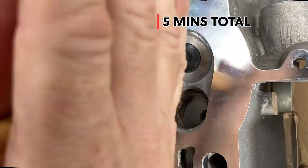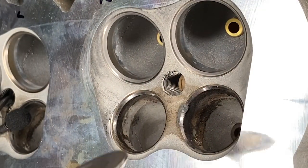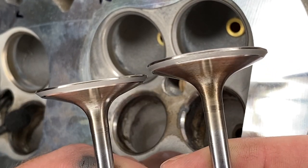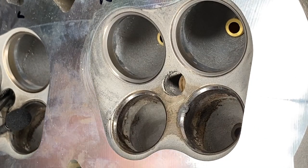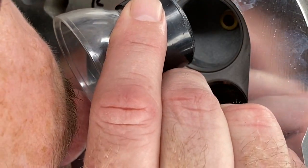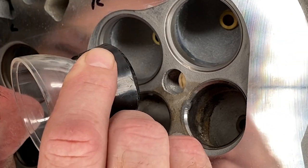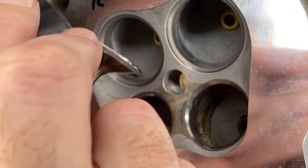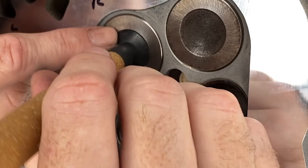On the right hand side is the five-minute valve, and on the left is the 10-minute valve — you can visually see that the 10-minute valve is better; it's much smoother. I did find that much more than 10 minutes didn't really seem to make much difference. I'm using an 8x loupe here to check the valve seats and the story is the same: 10 minutes good, five minutes okay but not quite enough. And so 10 minutes is the magic number.